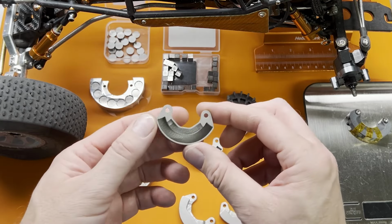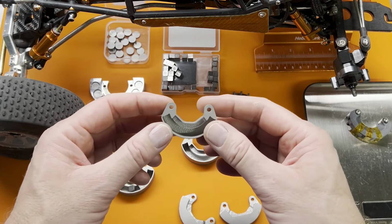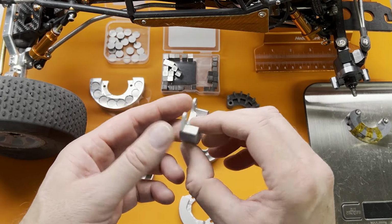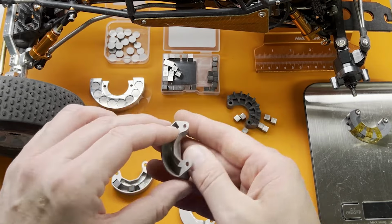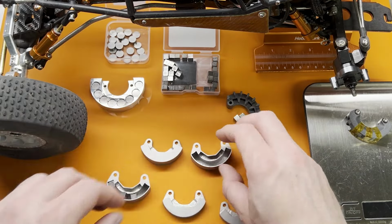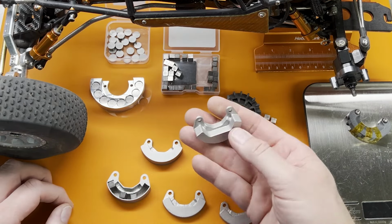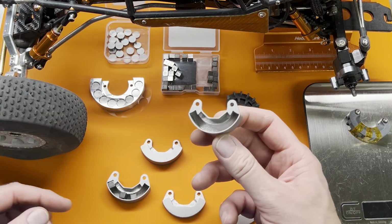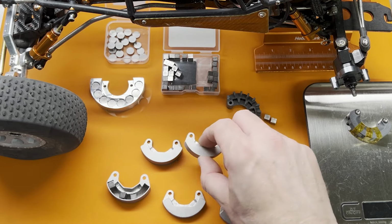but stainless steel is really common for 3D printing. For whatever reason, the powder is really conducive to the laser sintering process and also binder jet molding process. So you can get really nice stainless steel parts that are heavy, that are accurate, and look great. You can also get aluminum and titanium, although aluminum is substantially less strong when it's 3D printed. Stainless is kind of the go-to. Titanium is half the weight of stainless, which isn't a factor in this application, but it's much lighter and it's probably 4 times the cost of stainless steel.